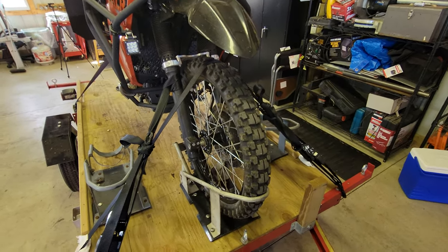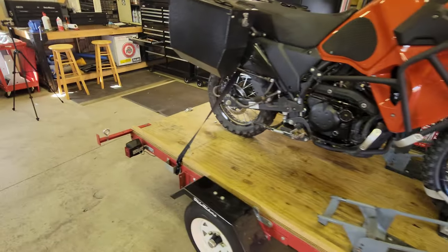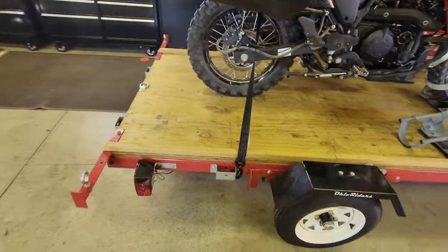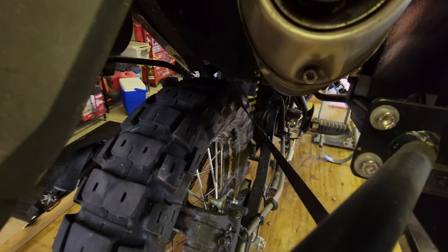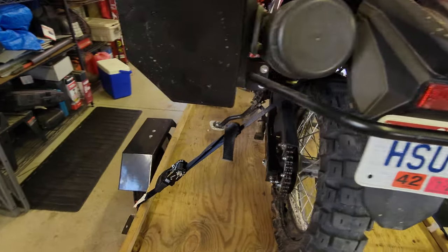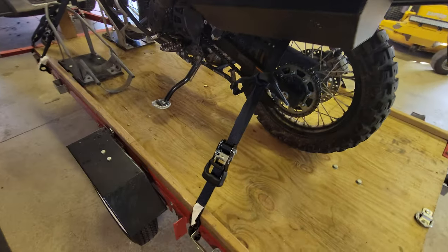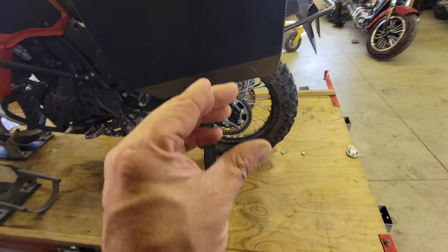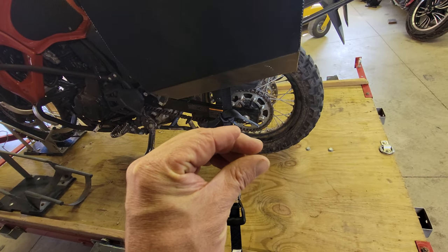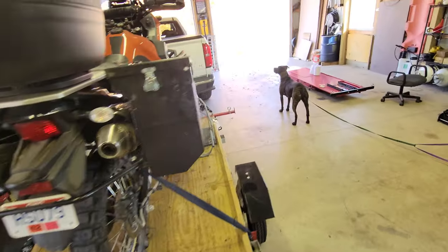In the rear you can do it a couple of different ways. With dual sports and the big knobby tires, honestly all I do is throw the strap up over the tire — you can see it coming out the other side. I try to get it as parallel with the rear axle as I can, and I'll just tighten it down until the rear tire has a little bit of a squish and it's not going anywhere.